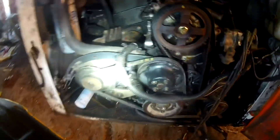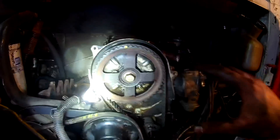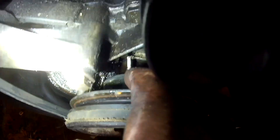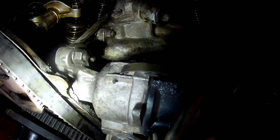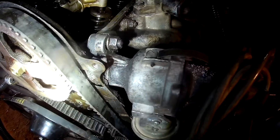I shouldn't have to time anything for that. But on the timing - there's a little dimple here with yellow paint that matches up with the yellow paint right there. I know it's not perfect because I spun it when I was getting the timing belt on a little bit. And then there's a pin - it's hard to show you guys anything one-handed. There's a little yellow paint mark in the line on that pulley that lines up to show top dead center, and there's a little mark that would be going straight up along with this, and they're pretty much even. I got this slid back in - it's either correct or 180 out, I don't know which, but that's easy enough to pull back out and switch around.